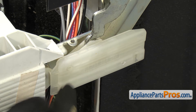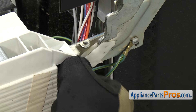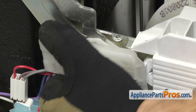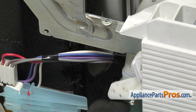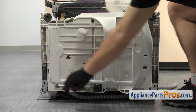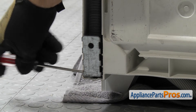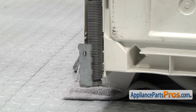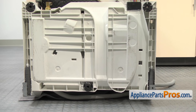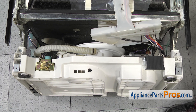We have to take the cover off each side on the hinges — all you have to do is press down and pull it out. Then we have to unhook the hinge lanyard to release the tension from the springs. All you have to do is lift it off and let it go. Once you have both of them unhooked, we have to release the spring tension so we can pull the base off from the frame. We're going to take a small flathead screwdriver and get behind the bracket and pop it out — once you have it out, you can just leave it hanging there. Once you have both springs out of the base, we can go up top and remove the four screws that hold the base of the frame — two on each side, with an upper one and a lower one that comes out with this bracket. We're going to use our Phillips screwdriver to take them out.